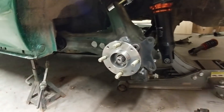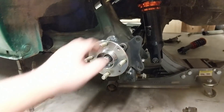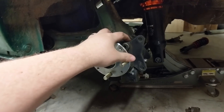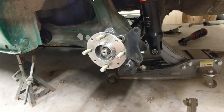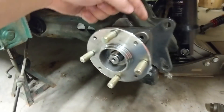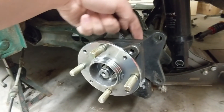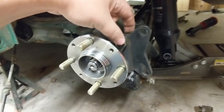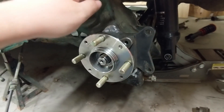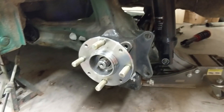Since I've been DIYing the entire back of the car, I made my own. I am trying to sell a couple to people who already know about them — hopefully later this week. One thing I'll note: this bolt here I'm going to put a stud through and weld it on the backside, drill out these threads, and put a nut on this side. All the other bolts will bolt to the RTA, and then I'm going to weld this bracket to the RTA as well to hold everything in place.